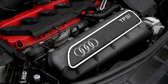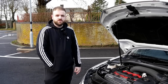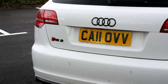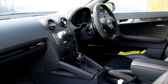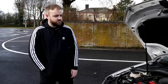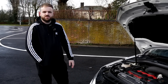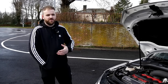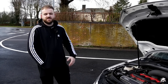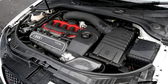In terms of the hybrid, I've got a TTU 510S hybrid from Turbo Unit from Ben White, making around 535 bhp and about 710 Nm of torque. That's been built for about six years. Originally I was on a TTE 500 hybrid, but after about three years I wasn't too happy with the way the TTE was, so I changed it to Ben's TTU 510S — it's better for the street because the low-end power picks up a lot quicker. The TTE was more high-end power. So in terms of street driving, it's just an ideal setup.